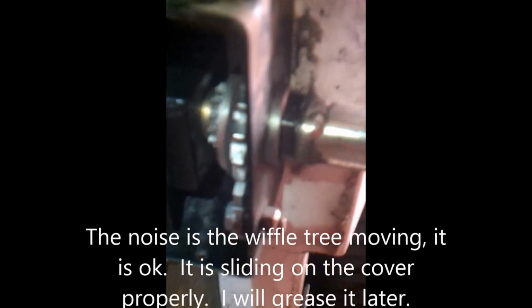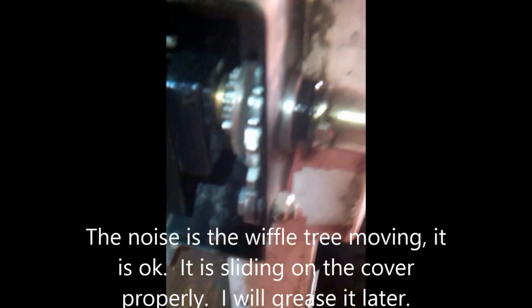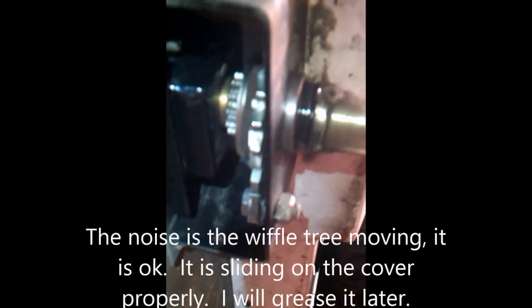So I get underneath my camper. You can see the ratchet going up. When I stop, the ratchet will hold the top up. I'm going to crank my shaft backwards. That's going to loosen, and you can see it keeps loosening, nothing's happening. It loosens the pressure off the pressure plate. Now hit that nut on the back side, and now it's coming down, and without the pressure on the pressure plate, that ratchet's not holding anything.